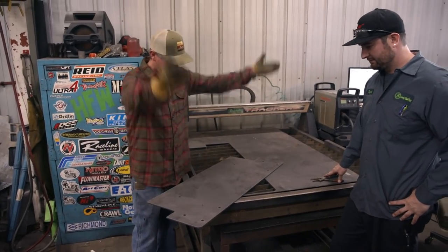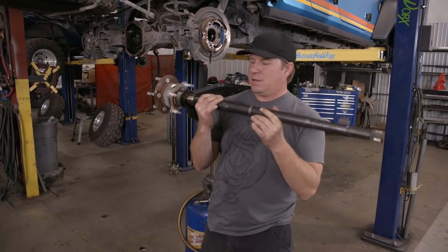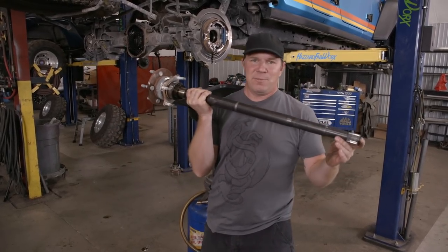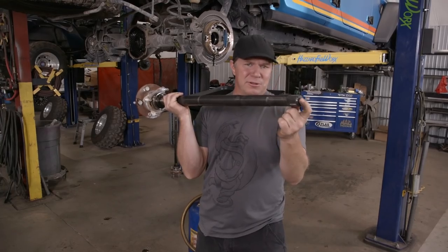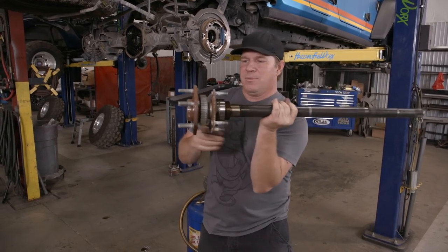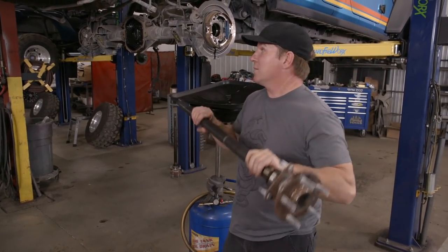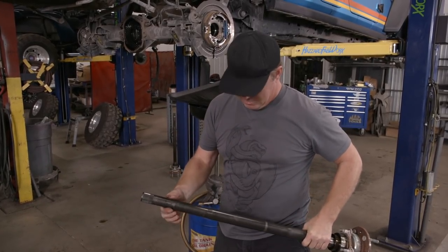It's the beginning of a big boom truck winch plate. This is the rear axle shaft out of the Gladiator — it's a Dana 44 by name, but it doesn't seem to be a Dana 44 by comparison to old Dana 44s. The spline count is 32 splines. Notice how the axle shaft necks up — at this end it looks like Dana 60 thickness, and it's held in by a bearing retainer, not a C-clip axle. So this is a pretty beefy axle shaft for the back of this truck.